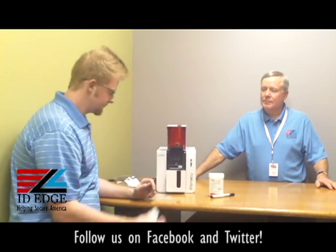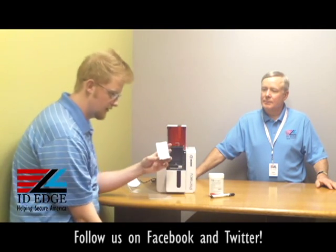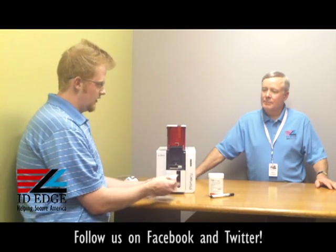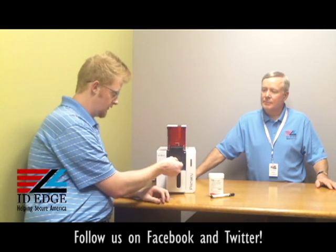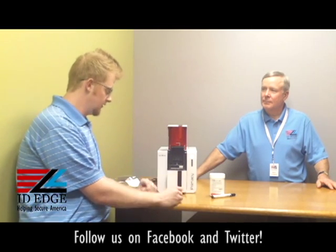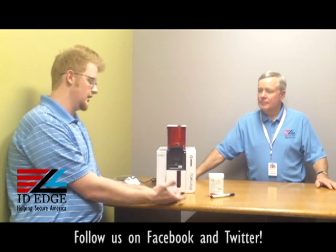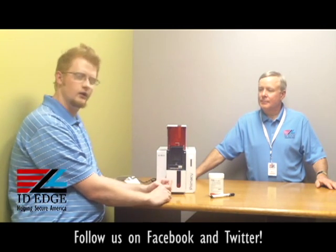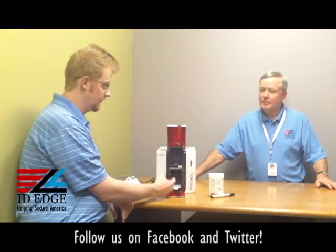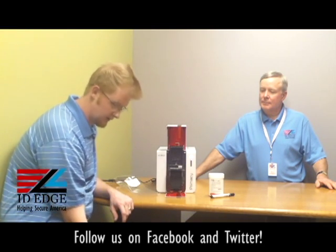So when that's done, you'll go ahead and take the adhesive off of the adhesive card. There's only adhesive on one side, the other side's just PVC. Enter the adhesive side up. And the printer will take it in. It'll run it back and forth through the printer a little bit, and all this is doing is picking up any of the little fibers that the cleaning card left behind before. So it'll eject down at your eject hopper, pull that out, and you're all done cleaning the rollers.